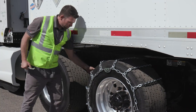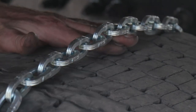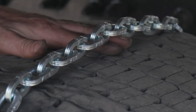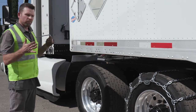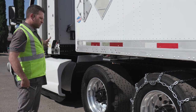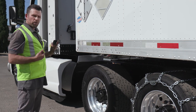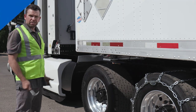Visually and tension-wise this looks good, but you need to make sure you monitor the process. We did our last vehicle rotation — a couple of rotations to let the chain settle — but as you start on your journey, always keep an eye on your chains because they're constantly going to be adjusting.